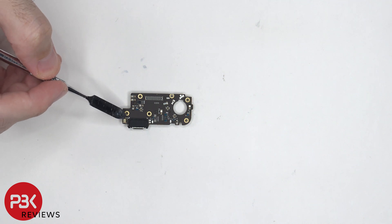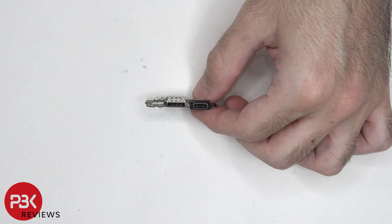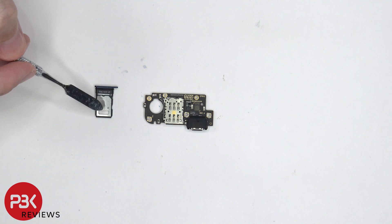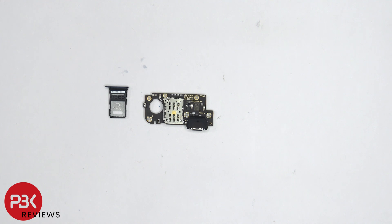The primary microphone is located on the corner of the subboard, next to the charger port. The SIM reader is located on the back side, and it does seem to be a dual SIM reader, or a memory card and SIM reader. The reason I say that is because there are pins on the top and bottom of this reader. When we take a look at the SIM tray itself, the SIM card slots over here, and on the back side there's a slot that's smaller than a SIM size and looks to be an SD card or memory card size. There's a logo of it drawn with an X on it, pretty much telling you not to put one in there, since this version is advertised as single SIM only. But from the looks of it, just like previous model phones, if you were to swap out the SIM tray and flash software that has a dual SIM or memory card reader enabled, those additional pins would start to work and you'd be able to make use of those features.